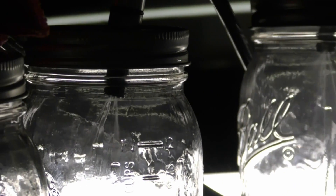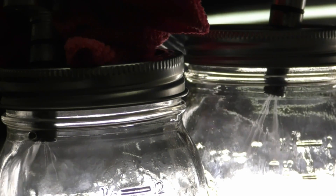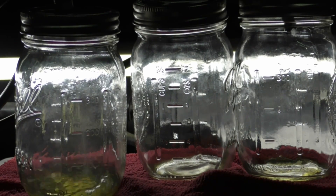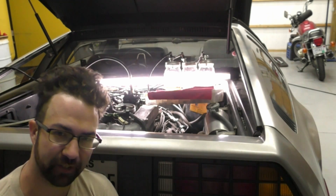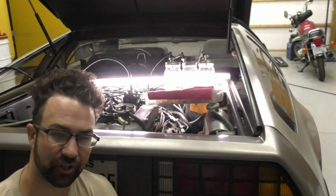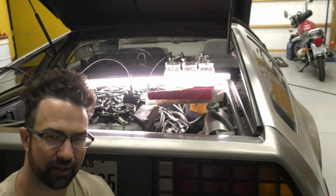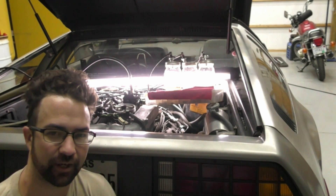After watching that fuel pressure test for a little bit, you can see that all of our injectors on the driver's side of the engine are spraying and spraying evenly. Over here on the passenger side of the engine, cylinders one and two are not spraying at all. The three injectors on the driver's side spray with decent spray patterns — they're spraying equally, filling up the jars. But the three injectors on our passenger side: one is quite clogged and spraying only a little, and the other two are so clogged they're not spraying at all. So next we're going to throw them in the ultrasonic cleaner and see if we can revive these injectors. If not, we'll need to go ahead and replace them.